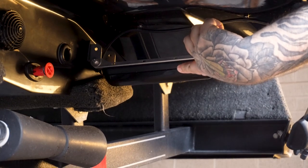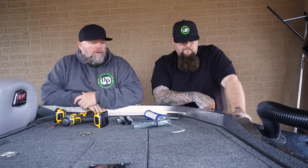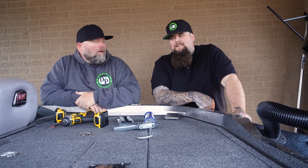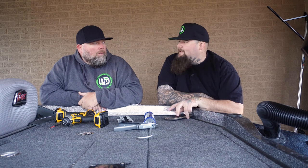This is what we're doing. We are replacing the transducer mount from right here to right here. It actually hangs lower than the hull of the boat — about three quarters of an inch lower than the hull. Which means we're losing speed. It was brought to our attention by Tom down at Fish and Fun. He said if you run a bead of caulk underneath someone's boat right on the hull, all the way across, they'll lose at least 5 to 10 miles an hour. And that's why this thing is moving — because it's below the hull. When you're on plane, it is dragging. We're not getting enough RPM — 5,200 RPM on a boat that's supposed to get almost 1,000 RPM higher than that, which equals at least 5 to 10 miles an hour more.